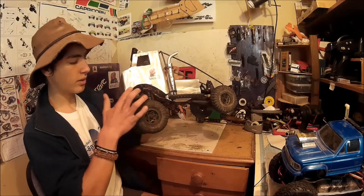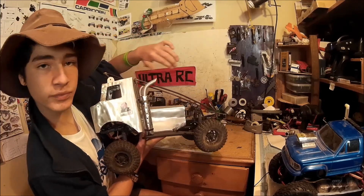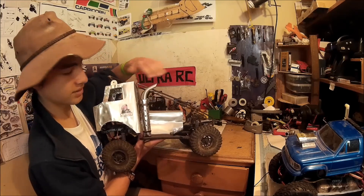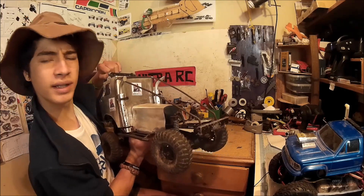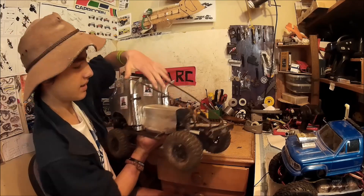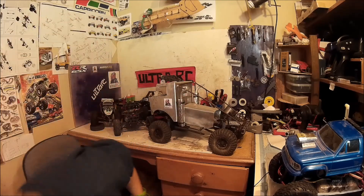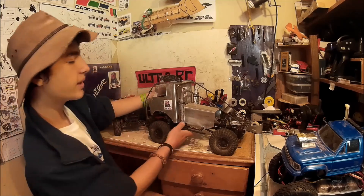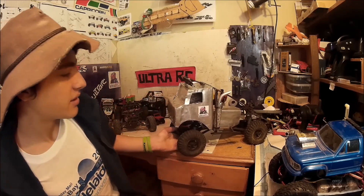The lift kit was needed because the wheels were rubbing on the shell. I also got these smokestacks - aluminum tube heated up, bent, drilled holes in it. Then I got a four-millimeter steel rod, chopped it into sections, bent it, and welded it together up top. I've got another section down here I was going to put on the front, but it's already looking very heavy. I'm still going to make a bumper and some other stuff.